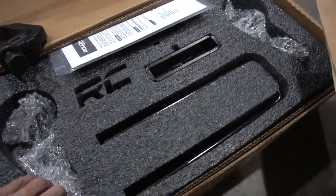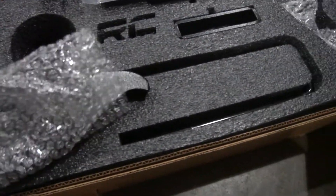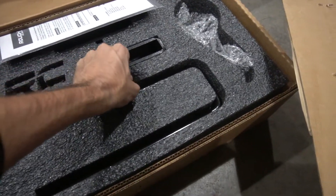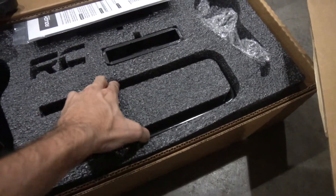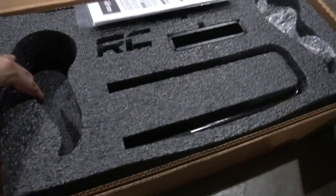As far as this kit, it comes with new keys. I figured what's going to be different really about this key versus the key that comes with the Cognito kit, so we should be fine there. What I do like is this one actually comes with blocks for the rear — probably about an inch to inch and a half block that'll go in the rear so we won't sit with the Cali squat. It comes with new hardware for each side, and underneath is all the new shocks. What was cool about this kit is it actually came with diff spacers.